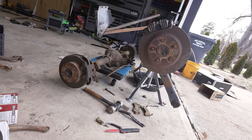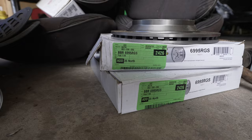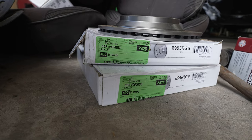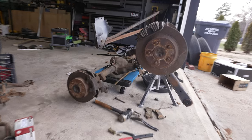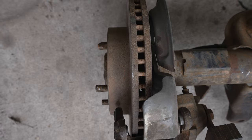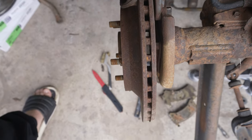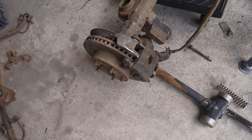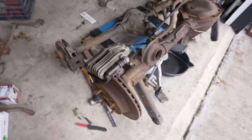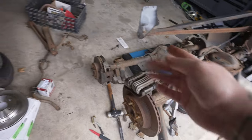The rotors are easily findable — I just got a set from O'Reilly's. They do have a part number; I found them by looking up an '89 Camaro IROC Z rear disc rotors. These rotors are also a lot thinner than the standard rotors — the standard rotors are pretty thick by comparison. I believe the calipers are both single piston calipers, so I'm not sure why this setup stops better than that one, but apparently this is way more effective at actual stopping.